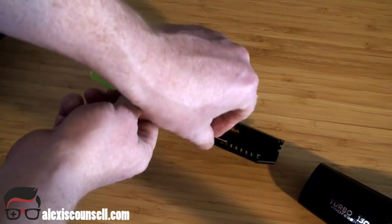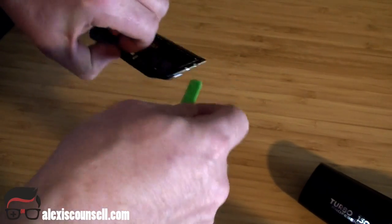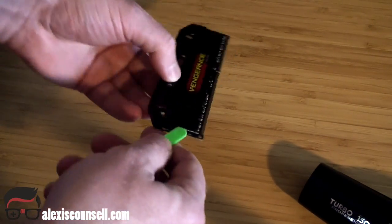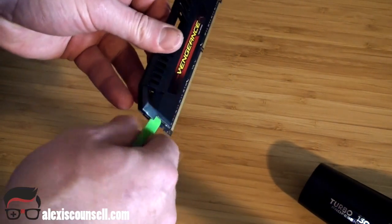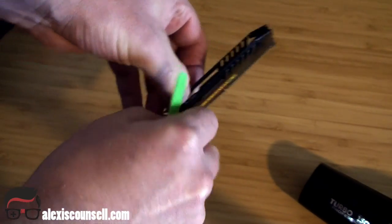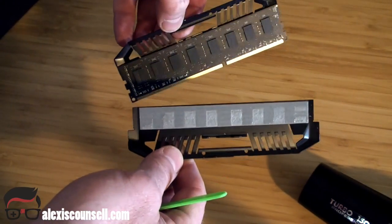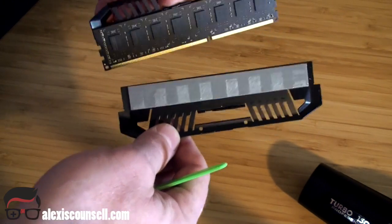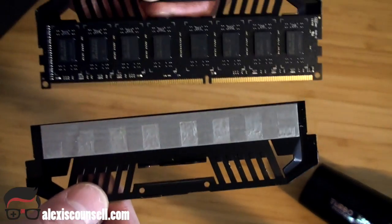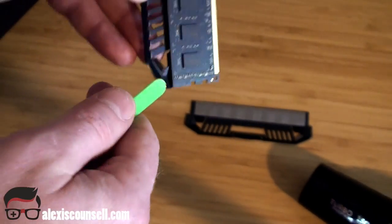Okay, decent bit more heat. Yikes, how hot is that? Yeah, that's hot. Let's work quickly before it cools down. Let's get in there — try from the other side. Nice squeegee sounds, it's coming off. I'm just going to pull very gently from the top. See, it's just coming apart there. Cool — that one came off really cleanly. So it's really easy, just patience and a little bit of heat. Make sure the glue is evenly warmed up. That one came off really nicely — you could probably even just pop that back on if you were going to sell the RAM or use it somewhere else.